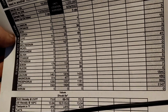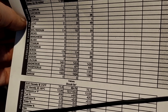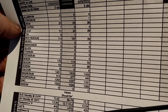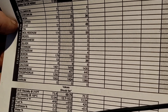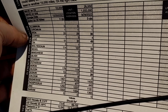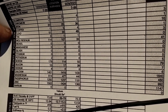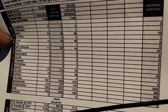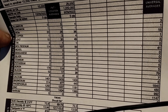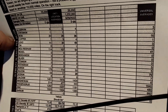That's what I found to help out so far on the camshaft issues that I was having on my previous engine. After I went through that, I started adding some zinc additive in there, because the old oil when these engines were designed had a higher zinc level than what the modern oils do. They reduced the zinc — I believe in 2007 when they came out with the diesel particulate filter — because the zinc is bad for the particulate filter. I just want to throw that in the video as well. I think there's some more information in the first video I did on the 25,000 mile oil change if you want to go back and watch that. Thanks for watching, we'll see you guys in the next video.